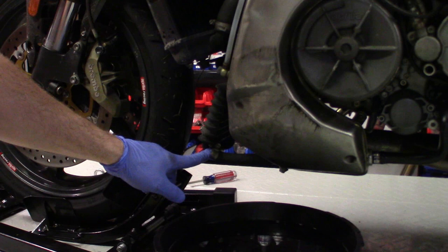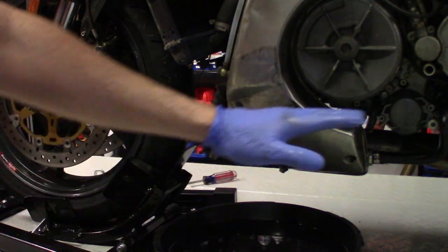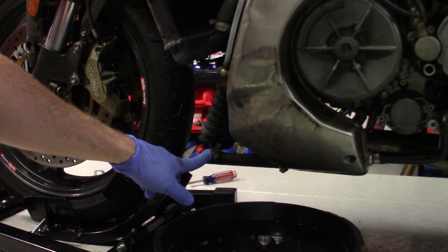Normally I would drain the oil cooler, but I'm not going to this time because the oil wasn't too bad. I pulled out about four quarts — an average oil tank and oil filter change should be 4.121 quarts, which is equivalent to about 3.9 liters. Go ahead and start filling the oil tank up and double-check all your fittings. There's your oil cooler drain if you really want to drain it. On this side is the oil screen plug but you're going to have to break the band clamp — I have those bands and they're a pain.